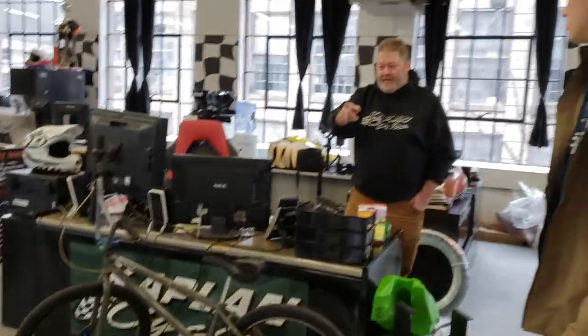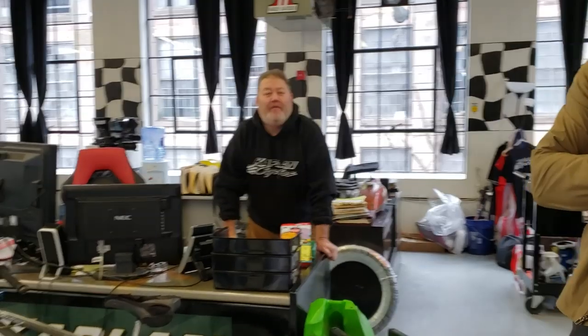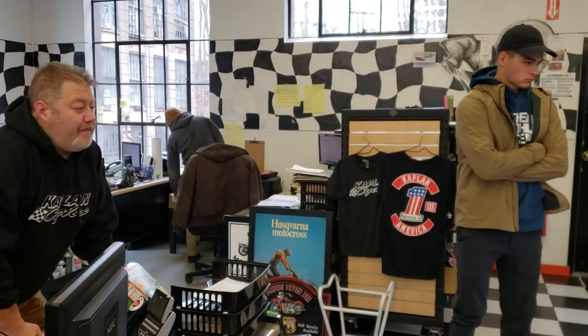Another interesting thing about this bike is the dual plug head. Now that came stock on the ELR Kawasakis. Oh, Eddie Lawson replicas had those? Correct, but they were a J head motor. So this is really unique, seeing an old KZ style head dual plugged. And it definitely helps with the big chamber.